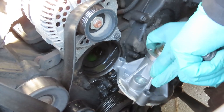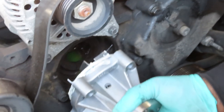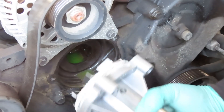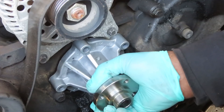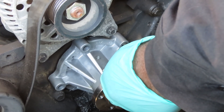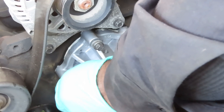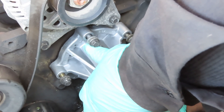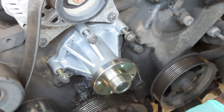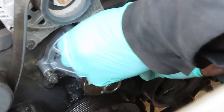What we're going to do is install the water pump now. You see that little big circle right there? That's going to go straight down. So you want to bring the water pump in — where do my bolt holes line up? There we go. I'm just holding it right there, not going to force it in yet. I'm going to put my bolts in by a couple threads so that now I've got my pump lined up. The next thing I'm going to do is go ahead and wiggle that pump till it goes right into place, just like that. You definitely don't want to use the bolts to pull that in.